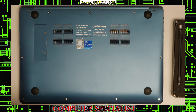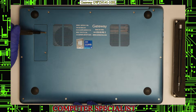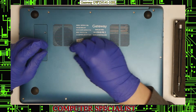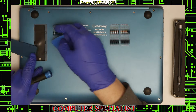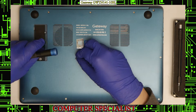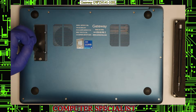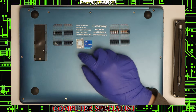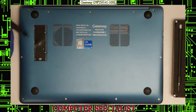We're going to be showing you how to disassemble the computer so you can replace parts or do whatever you want. Both of the drives in this laptop are regular SATA M.2 drives — they aren't PCIe NVMe drives, so you can't swap them out with a faster NVMe drive. You're stuck with SATA drives. There are two slots: one on the board itself and one expansion slot. So if you want to upgrade storage it is technically possible. The memory is not upgradeable, but the storage still is.